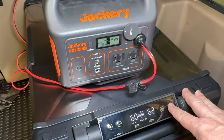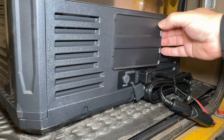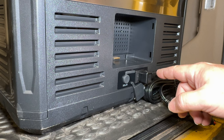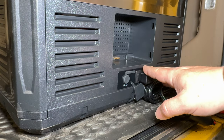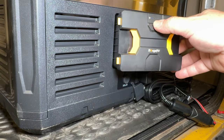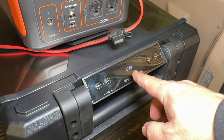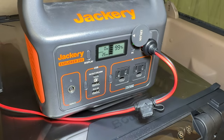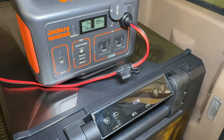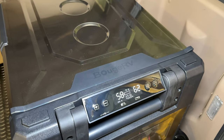This does have another neat feature that my other fridge does not have. If we open this door right here, there is a battery port — we can plug a battery in here which will give us about two to three hours of run time when the car is not supplying power. I have one of those batteries right here. It looks like it is discharged so I'm going to pop it in and let it charge up. You can see on the display it is charging the battery. Charging it looks like it takes 26 watts, but at 12 volts that's only just over two amps.